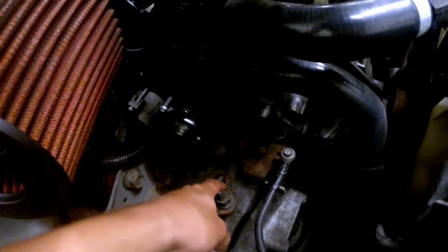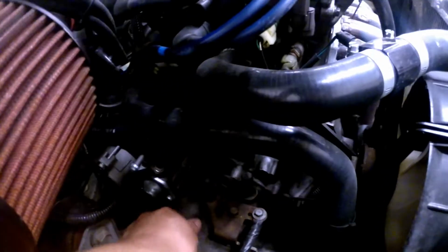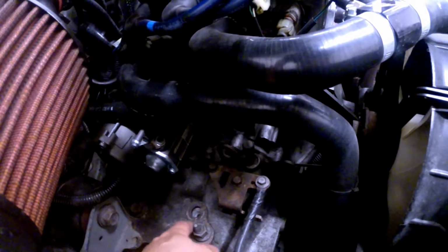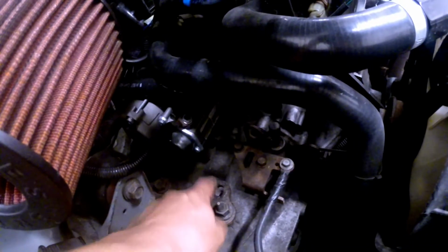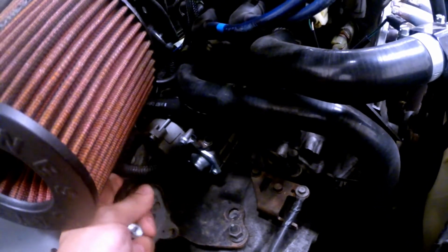So we're going to put a Helicoil. We're going to drill it out, oversize it, and put some Helicoil, so we can put a new hardware bolt in it. Because I already see right now it's not going to tighten because there are no threads on it. Right now it's being held by a bolt and a stud with a nut on it. Then we're just going to get it ready so we can upgrade to the new motor mounts.